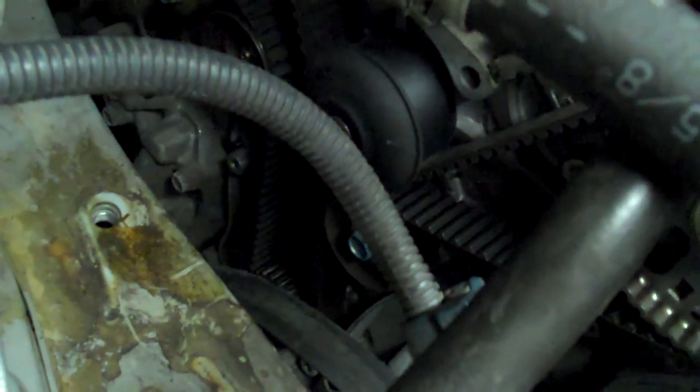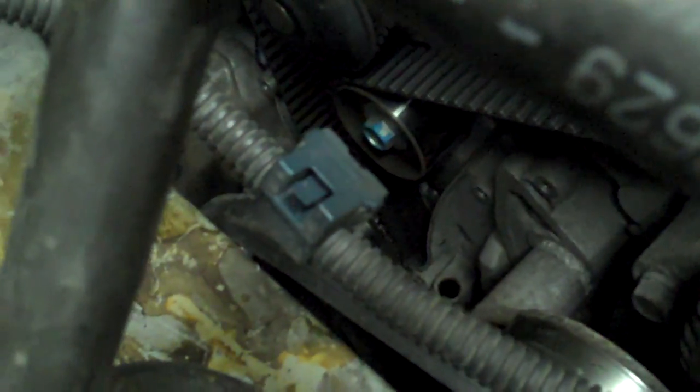The reason you've got to do that is below that there's a motor mount. There's 3 parts to it. The first one I pull all together. It sits in there like this, and it actually comes out through this opening here behind the lines. You got to unbuckle that little part of the wire harness off, get it out of the way, and then you've got a bunch of 14mm bolts. You've got 3 on the top, and then there's 2, 1 on each side down at the bottom. So you pull that up and you set it aside.